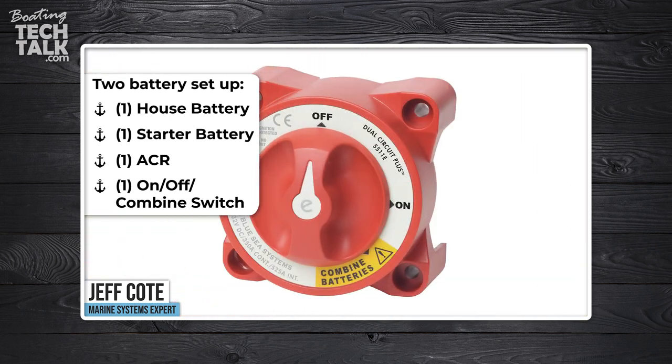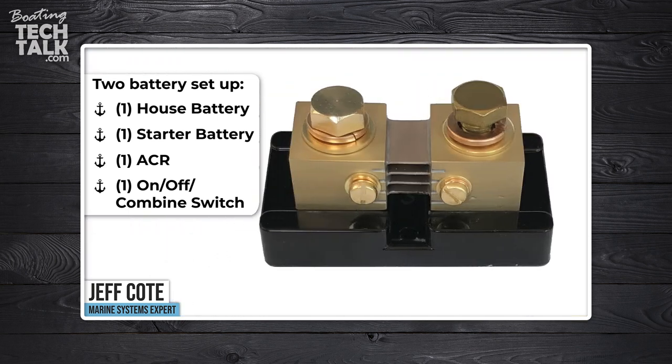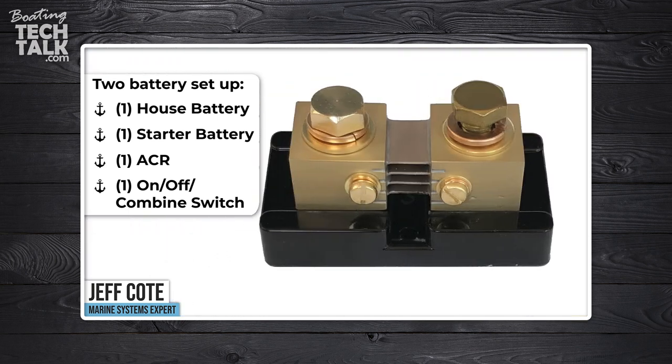He also has a switch on it, which is handy — an on/off combined switch — which means you can force it to manually be on, always off, or force it to work in auto. His question is: can you still use a single shunt, with both battery negatives on one side of the shunt and all loads on the other side, for use with a single battery monitor? Or would it be preferable to have the starter and house batteries use their separate shunts?